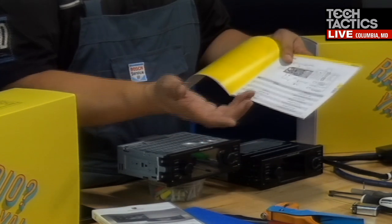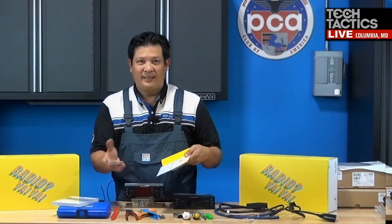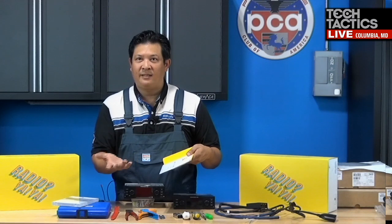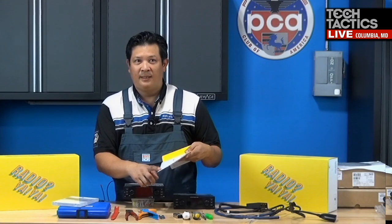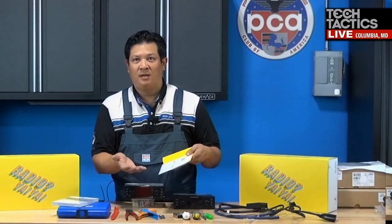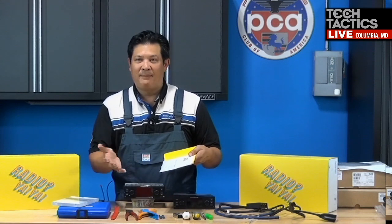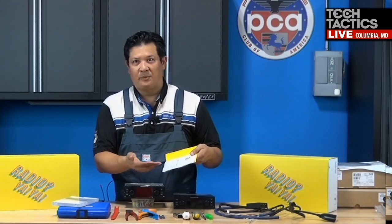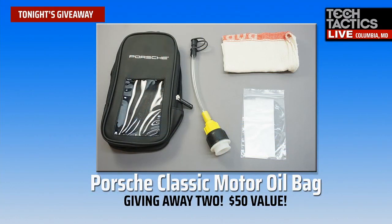to your speakers. And if you have an amplifier in your Boxster or your 986, you'll have to either get what's called a preamp line converter, where it accepts a powered speaker level input and creates a line level output to utilize the amplifiers that might be in your car. Or you can do what I've done with this car. If you're not running or need a lot of power, you can just bypass the car's amplifiers and run your speakers directly with the 45 watts that's built in. So there's your answer.